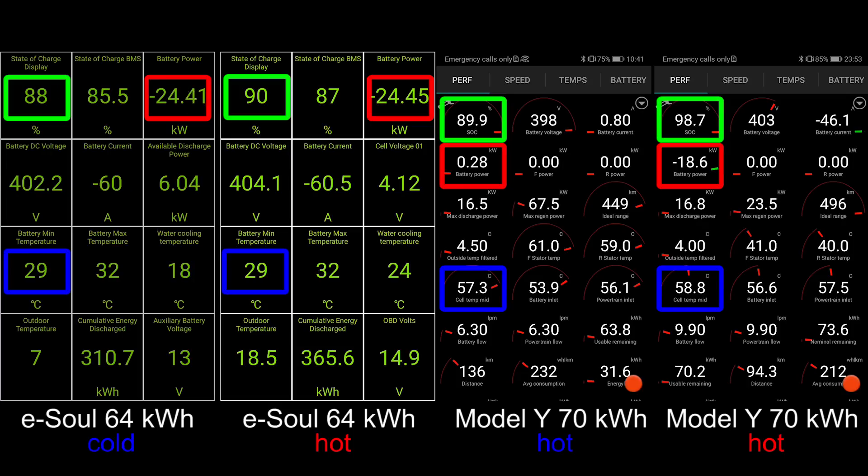If you guys want to see the data, we will finish in around 20 seconds. So it is slower — it takes longer time before it finishes, but it's not that bad, unless you need to charge from very low, maybe then it can be slow. One thing I should mention is that it is actually an advantage for us to start with 10% on this charging session. If you would start with 30 or 40% with a cold battery, then it's going to be hell, because you might not get any battery heater action. The battery will start charging slow because it's cold, but then it won't get any battery heater, and it's like a downward spiral — it charges slow and won't gain any heat from active heating, and then it would just charge really slow and recover way slower.